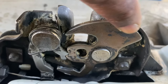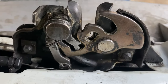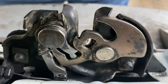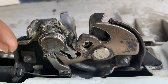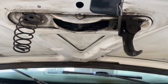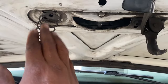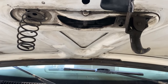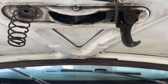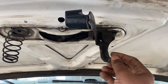How exactly does this hook open? This hood latch mechanism with the hook is only designed to open when the hood release is pulled in the vehicle, in combination with the spring on the hood pushing the hood up at the same time. Let's talk about that spring. Before we close the hood, there are a few things to know about what's up under the hood. Right here is a spring — that spring plays a critical role in why the car hood opens in the first place. You also have the rod that falls down into the latch, and then you have this mechanism here. When you open your hood, you've got to press on this to open this latch to release the hood as well.